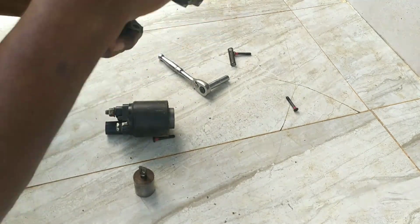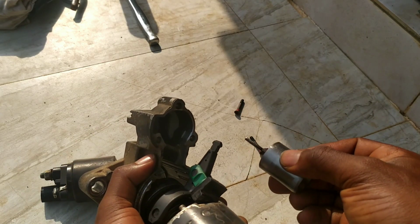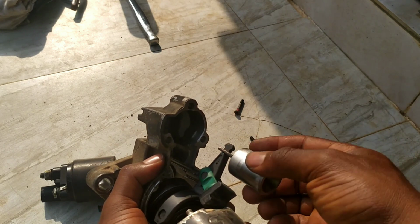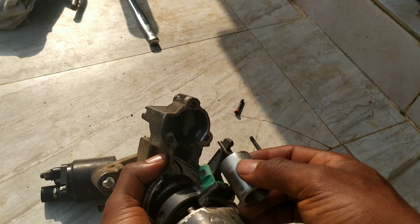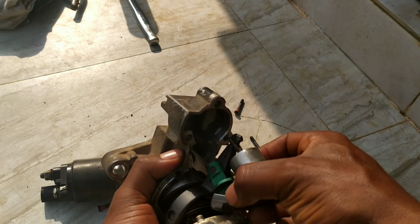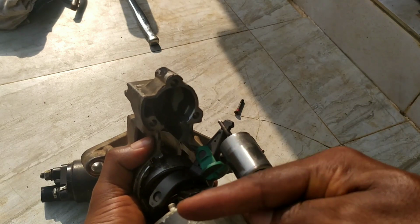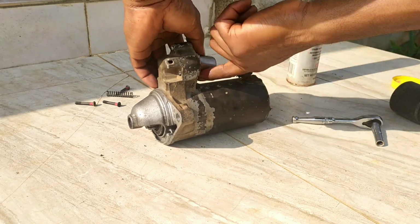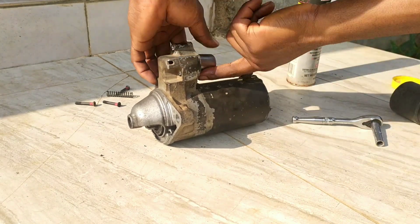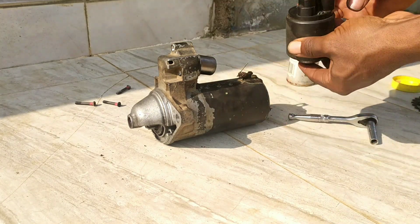So checking everything right here, looks good. It's much easier fixing the solenoid plunger before bolting the case on, like I'm doing now, like I just did. I just hung this on right here before bolting this back to this. So after tightening down the DC motor back to the casing, applying some lube to the solenoid plunger here, and then there's a spring. Don't forget that.